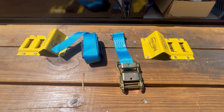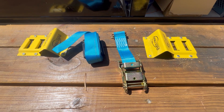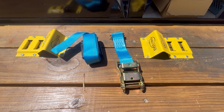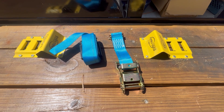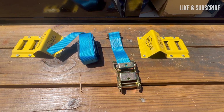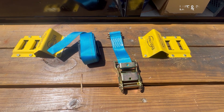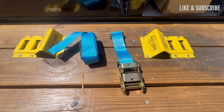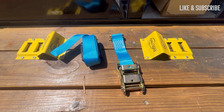I wanted to give one last follow-up on this wheel chock project. These ratchet straps have a tension rating, which is basically, if you have to stop in a hurry, the amount of weight they can handle increases by 3 times the weight of the vehicle. So my Ranger is about 1,400 pounds. And when I installed these Erickson system, the chocks and the straps, it was rated for about 1,500, and so I knew that wasn't going to work in a situation where I needed to hit my brakes.